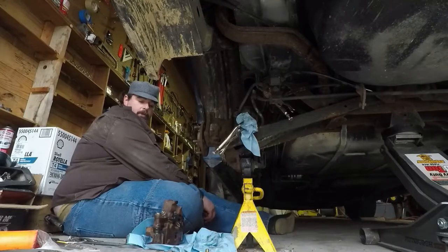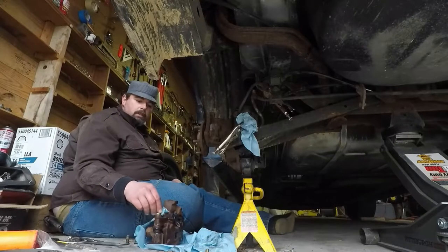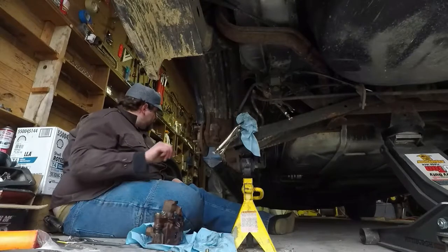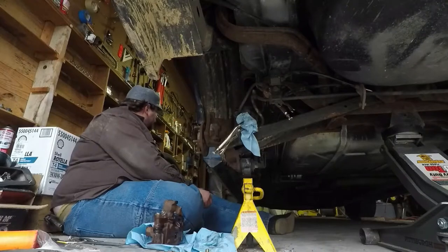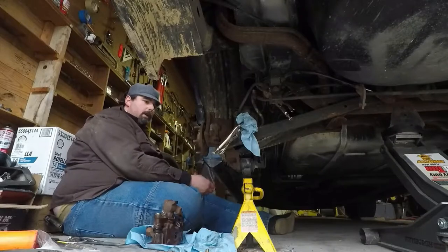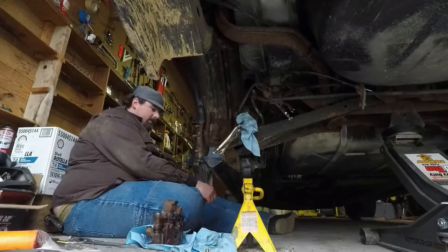It should be a 9mm, which of course is missing, like the 16mm. Deep well 9mm socket. Because only GM uses these sizes, GM and Jeep, and so you never get them in sets. Well, I shouldn't say just Jeep, Jeep Fiat, because I ran into it a lot on the Renegade. Now Stellantis.